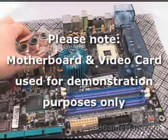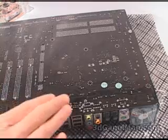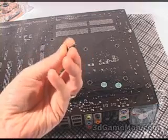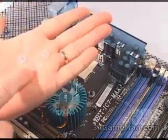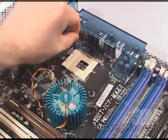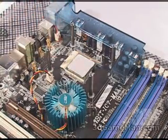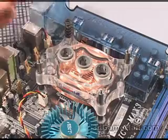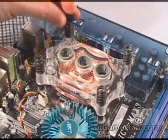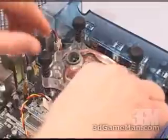I'm going to be installing this CPU water block on socket 478. First, remove the plastic retention bracket and turn the motherboard over. Put a washer over four bolts and push them up through the motherboard. Then put an additional four washers down over the bolts and screw four guides onto the bolts. Next, carefully place the CPU into the socket and apply a very thin coat of thermal compound. Finally, place four springs down over the guides, then four thumb screws down into the guides, and tighten each evenly all the way around.